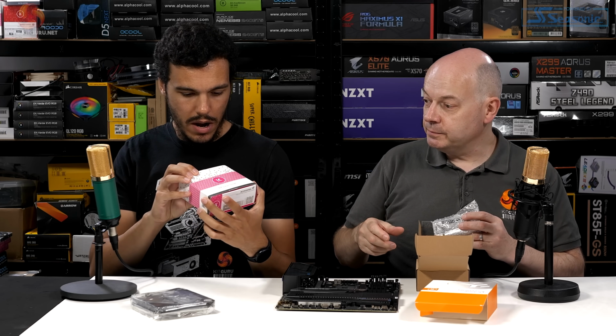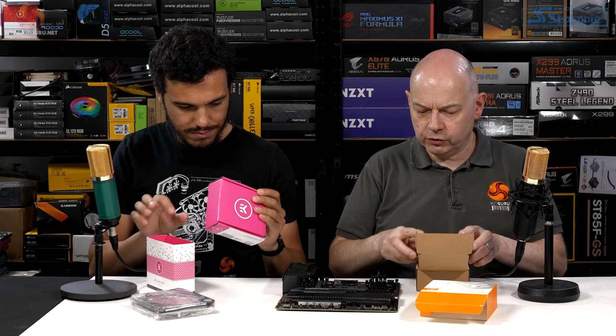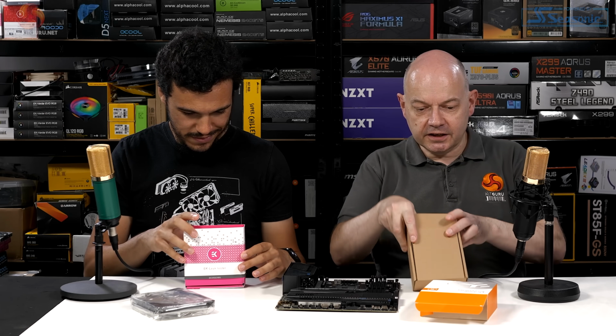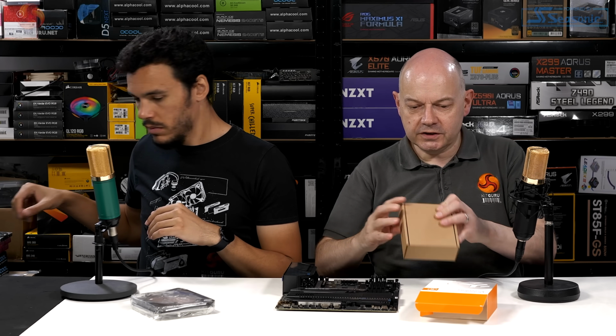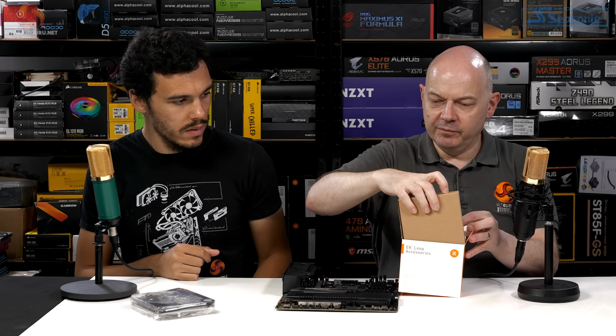So what it essentially is, is a bicycle pump. It's for plugging into your loop to check, which is about 30 odd quid's worth of hardware. Nifty piece of kit. So when your loop is assembled, you plug into the fill port on the reservoir or some such, and you basically confirm it's holding pressure, about an atmosphere. Okay. And if it holds that, it's all good.